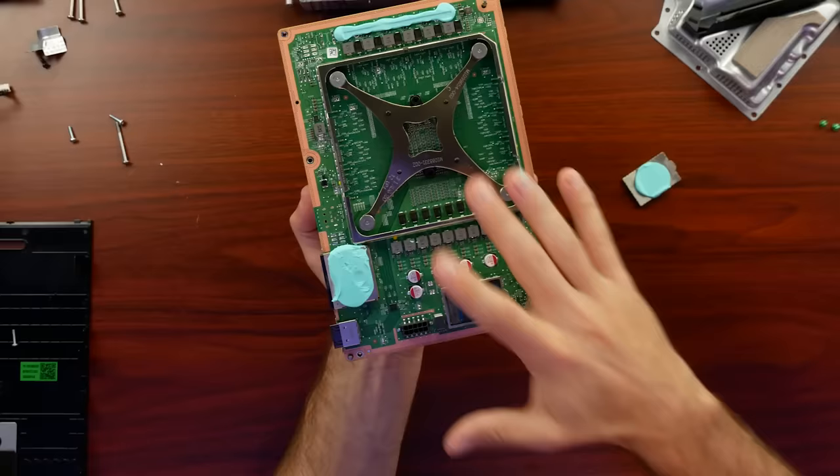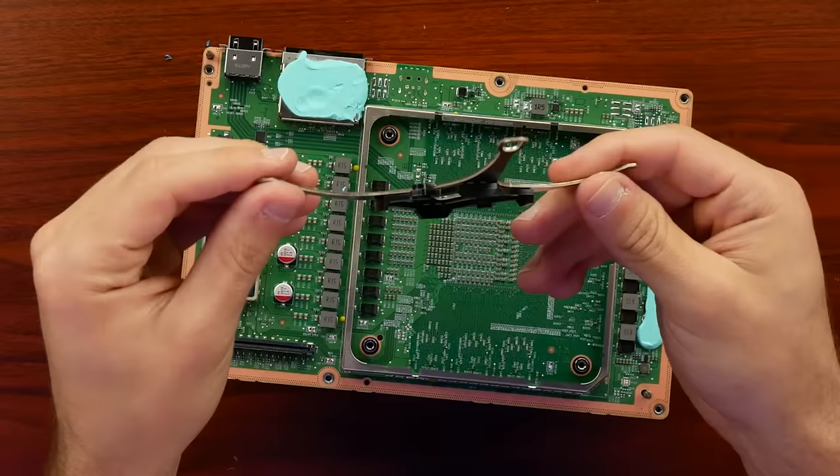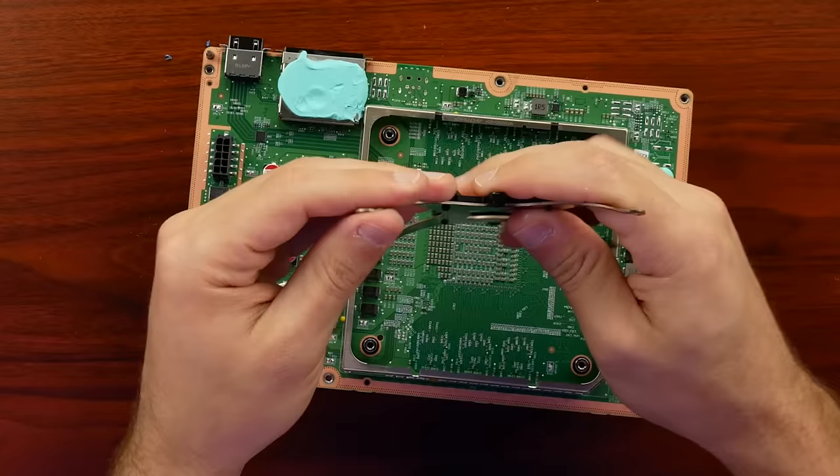Just keep in mind how far I had to go to get to this SSD — it is certainly not something I would recommend most people do. It is still somewhat tension-filled with those screws; you can see how much it bent up after I unscrewed it. Looks like they have some plastic guards here just to make sure it doesn't make direct contact with the board or put too much pressure in the middle with all those components. This is significantly better in terms of build quality than those X-Clamps we're so used to.